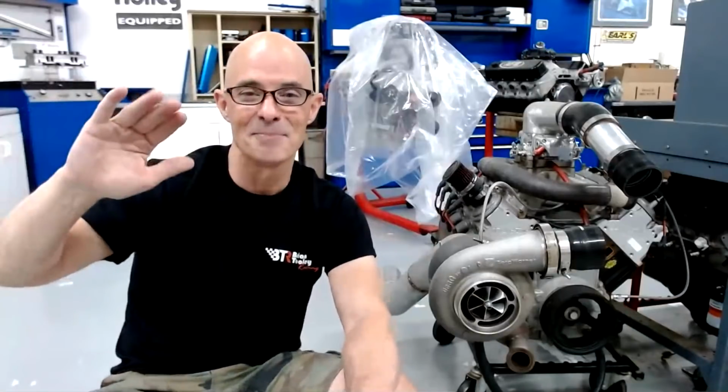What I like to do when we're first running a turbo motor on the dyno is we'll tune the NA stuff, interpolate up, double that, and then I'll add maybe 6 or 8 or 10%. Because when we load into it, I'd rather have it be 10 to 1 than be 12 or 13 to 1. I'd rather have it be fat and have no timing and then adjust that, rather than have it be lean and have too much timing. So that's how I go about tuning it.